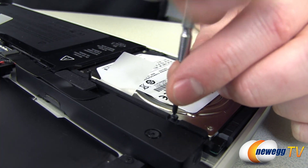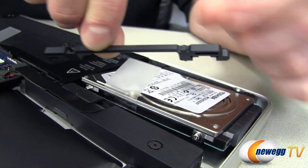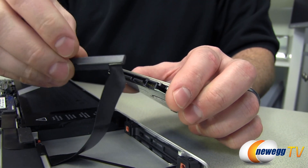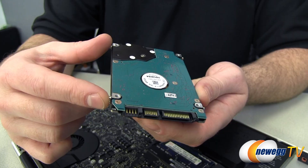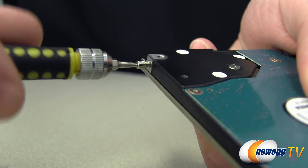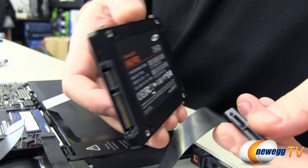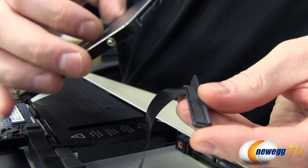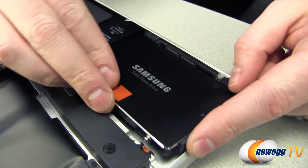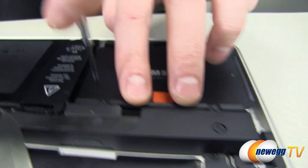You'll see two Phillips head screws — simply remove those from the mechanical hard drive and remove the plastic retention bracket. Next, lift the plastic tab, remove the hard drive, and disconnect its serial ATA ribbon cable. Note that the MacBook's hard drive has four small metal screws — you'll want to remove all four of those and reinstall them on your SSD. Next, install the SSD into that same position: connect the serial ATA ribbon cable, set the SSD drive in the bay, and remount and reinstall the plastic bracket and the screws.